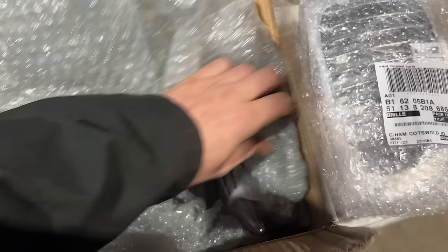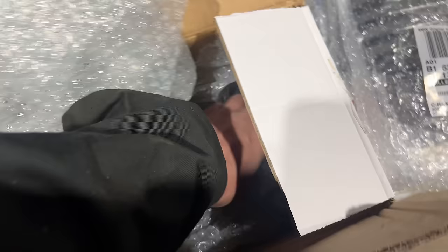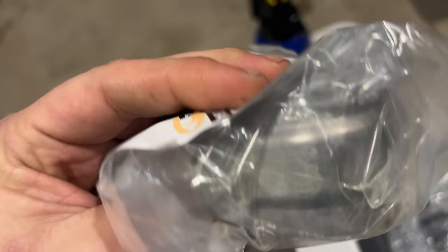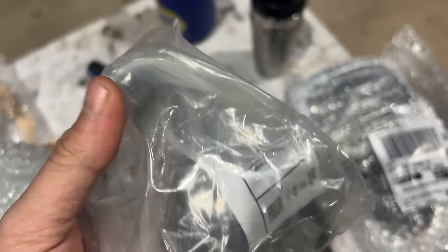So I got some new hardware for little bits around. The rear two bolts that go into the diff are actually torque to yield, or they certainly have an angle on them. I think it's something like 20 newton meters and then 90 degrees or something like that. And so I ended up getting some new bolts for them. I also got some new brackets for the anti-roll bar bushes because mine were pretty manky and I forgot to take them to the powder coaters. And by this point, I've got a bit sick of painting things in the freezing cold.